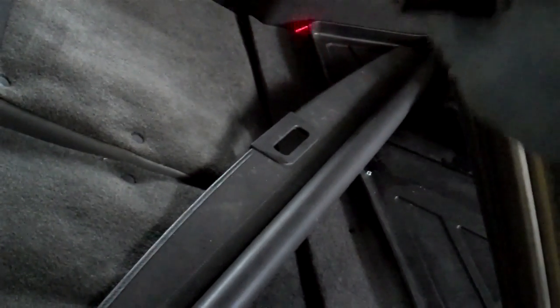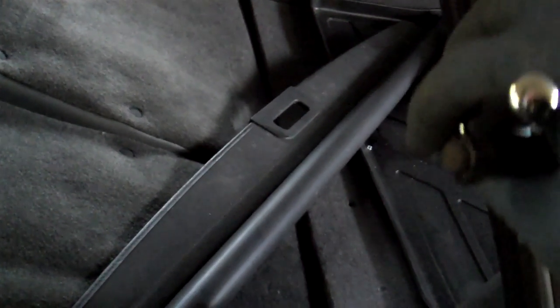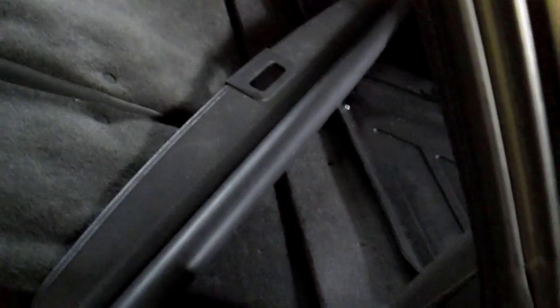I check the fuel pump harness. The fuel pump access — you put the seats down and pull up this little carpet. There's a little opening here and another opening here, and the fuel pump is under that. The fuel pump runs, everything's great with the fuel pump. By the way, in the owner's manual that's fuse number 16, and it says 'fuel injection fuse'.